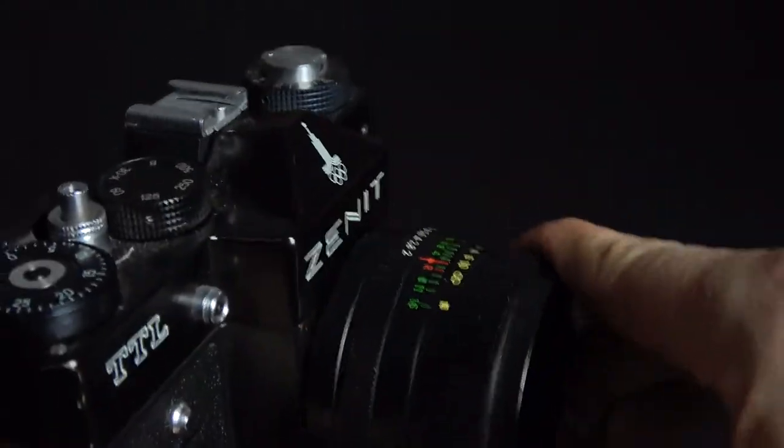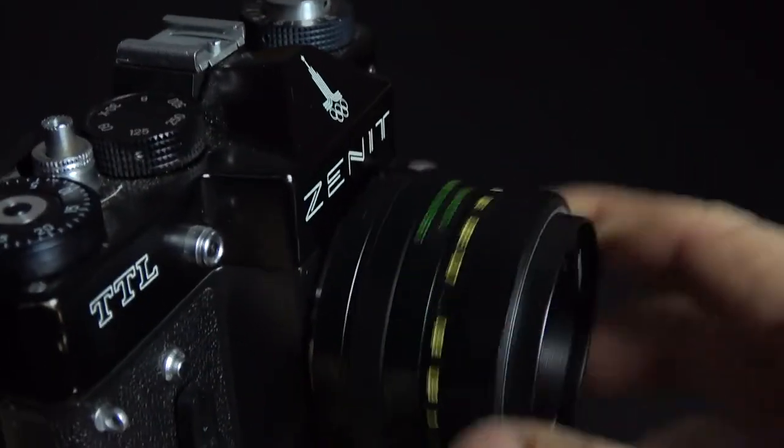But how did they do that? Well, they had a few tricks up their sleeve. First of all, they used what was considered to be outdated or obsolete technology. There is no bayonet mount on this camera — it's a screw mount, M42, which is pretty cool if you ask me, but it saves them money because there was no bayonet to be machined. It was a simpler technology. The aperture has no coupling to the rest of the camera, so the metering is done at real aperture, which darkens the viewfinder — which is already pretty dark — but more on that later.